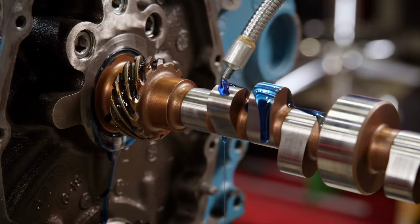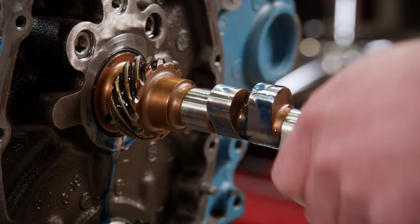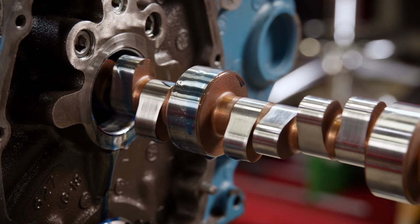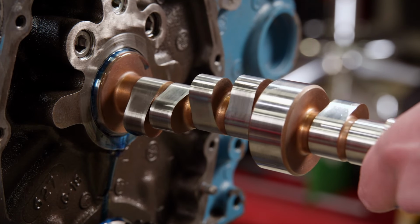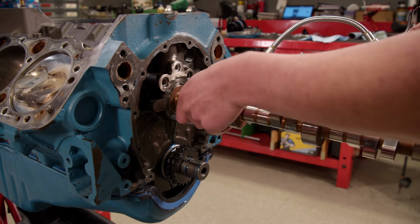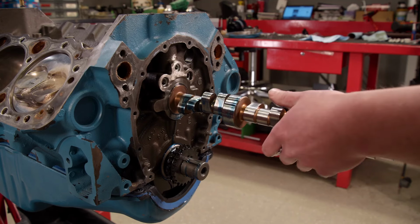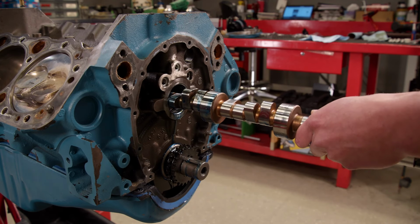Because this cam was originally designed for another build, it has a 900 thousandths small base circle lobe, which will help with clearance on larger stroke engines. This isn't necessary for this application, but it doesn't hurt either. You can tell by the slight wear pattern on the camshaft it's been used before, but it only has a few hours of dyno time, so no big deal.